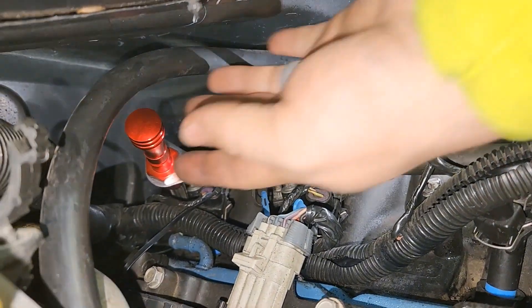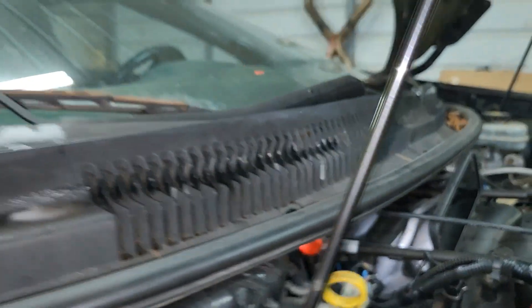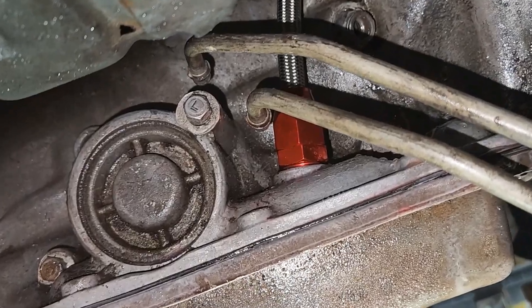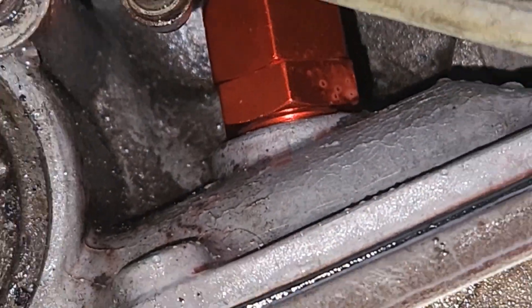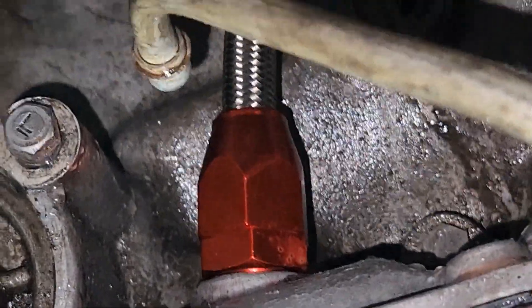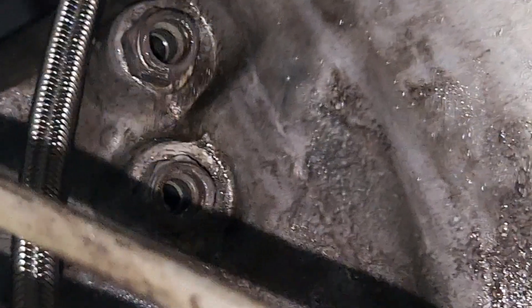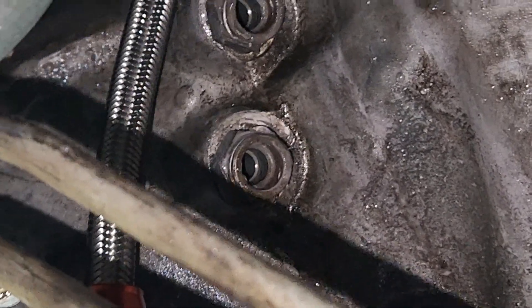I already went underneath the car and stuck it in the hole — it actually fits really good. It's the 29-inch and this is how far it comes up. He's just zip-tying it right there to the fuel rail. A buddy of mine had one of these on his car and it leaked, but that's a different brand. There it is in the hole — I took the seal out and stuck it down in there and it fits pretty good. I'd put some RTV around there if it were me, but you can feel the rubber seals where they seat. Now we've got to straighten up these transmission lines and get them in those holes — the push locks off the 4L60E screwed right in there.